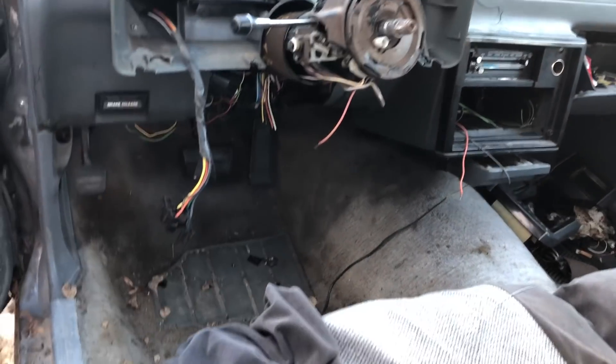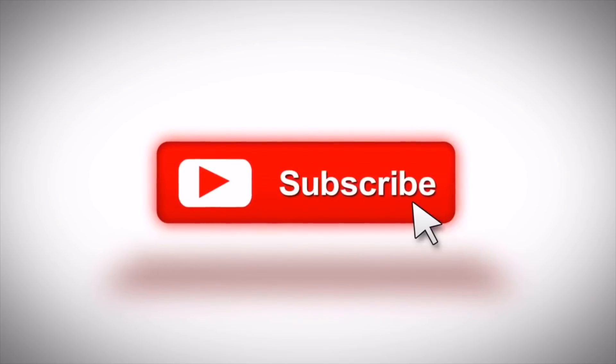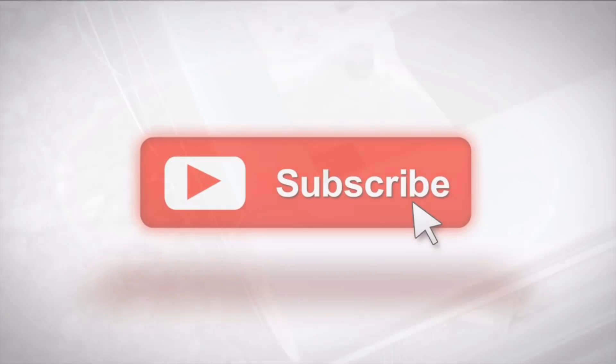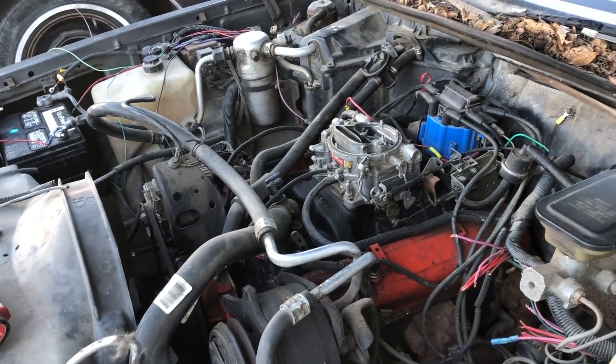So you can just say it ain't start for now. It didn't start. It's still connected, but it ain't getting no power. The only thing that had power was the distributor. Just about to keep doing some tests real quick. I took all that back apart because there's too many splices. I don't know what's going on, but I'm trying to figure it out right now.